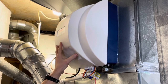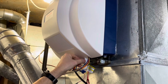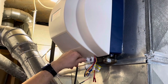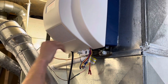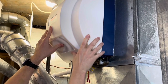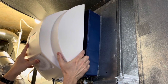The first step is to unplug it, then unplug the humidity sensor and the circuit — pull that out as well. There's a thumb screw on the bottom — unscrew that. Be careful if you have an exhaust from your furnace if this is hot. Hold it in place until you pop off the thumb screw, then remove this outer cover by shifting up, because there's a clip at the top that it rests on, and then pulling it back.